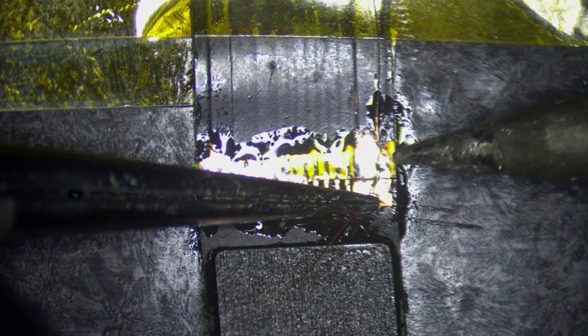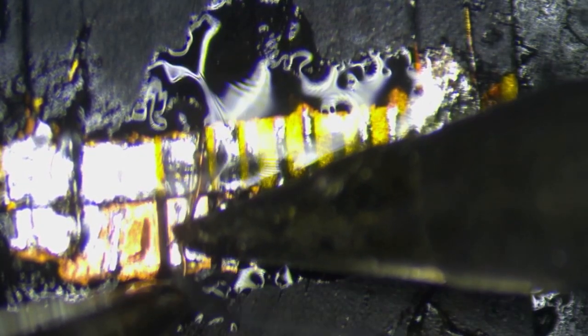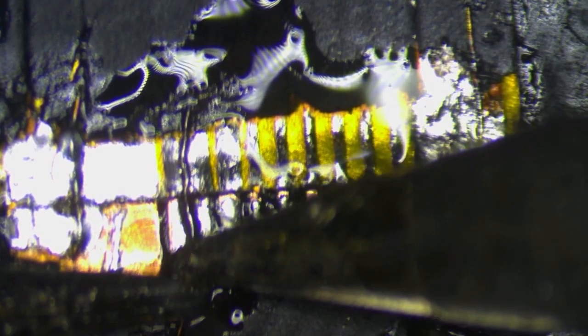The end result should look something like this. Now all that's left is to come in with some jumper wire — I use 0.01 millimeter diameter wire for this. We start off by tacking it on one end to the other. I always find it easier to do the thicker one first and move backwards from there. As I'm adding one end to the other, I'm running the jumper as flat as possible and then dragging my iron across to keep no slack and have it more bulgy and supportive of the connection, so it's not going to move around as the screen opens and closes and eventually break again. Rinse and repeat for every single trace. Be mindful of the work you've done right next to it — you don't want to knock a jumper you've just done because they're really easy to pick up. Don't get frustrated, it's all about practice. Just don't push it, never force anything or you'll cause more damage than repair.